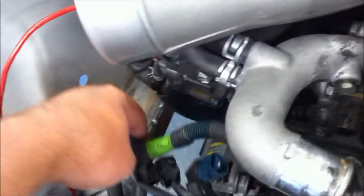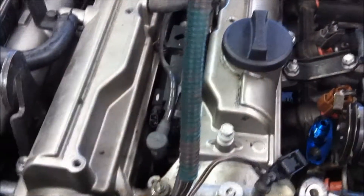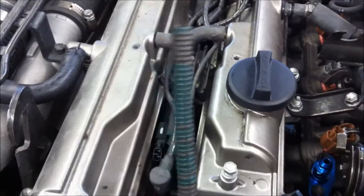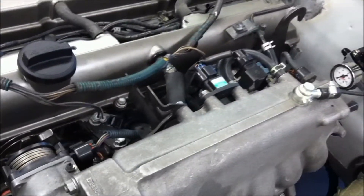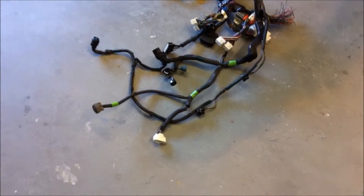This section loops around over here, and this set of connectors comes over here to the mass air sensor and all the turbo sensors. This little subsection here goes off to the coil packs and then down to the main harness right here. Once I get that unbolted, this splits back off and goes to the transmission. Those are all disconnected — just need to disconnect this section here which goes up to all the injectors and a couple of sensors, water temp and air temp.